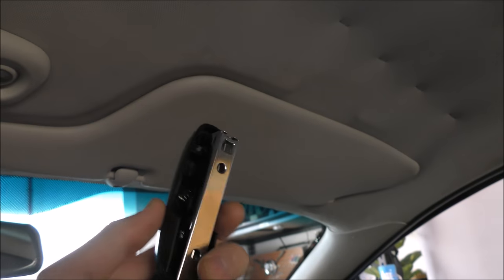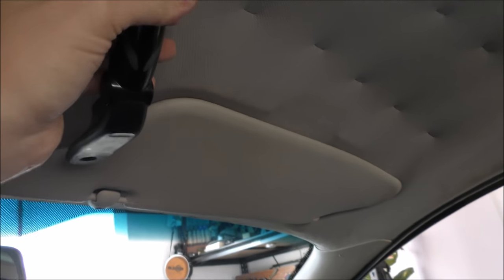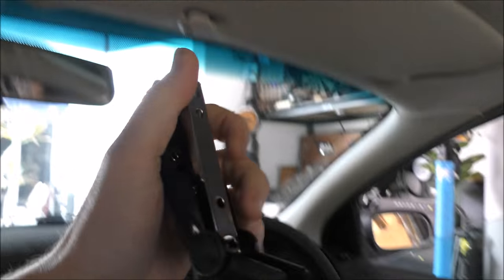And a good thing about this is when the upholsterer wants to redo this headlining one day, pulling off the cloth, the staples are going to come out quite easily, and the staples don't actually damage the board, because being just an office stapler, you're just going to be applying a small amount of pressure into the board to get the staples in. So I think if you're using maybe a big industrial type of air powered stapler, you may be forcing too much pressure.